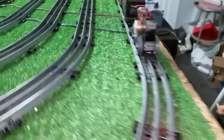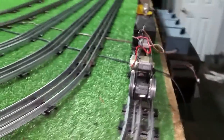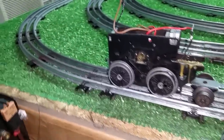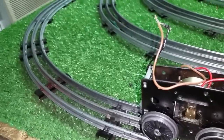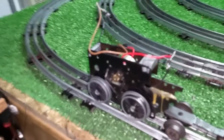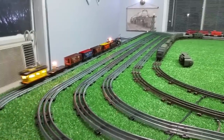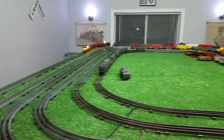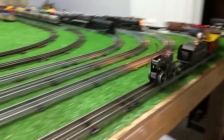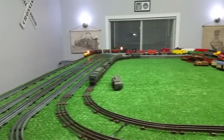It's a really simple way to get one of these motors up and running. This is a DC-only motor — it will not run on AC at all. So I set up the DC transformer and supplied DC to it to make sure the motor was good. Then I took the old circuit board and scavenged two of the diodes off of it. It was actually the integrated circuit on the circuit board that had gone out. So by adding these two simple diodes, we convert AC into DC and the motor is up and running. This runs forward only, but it runs — and it actually runs really, really well.